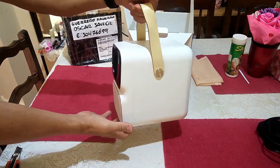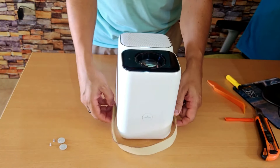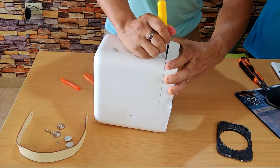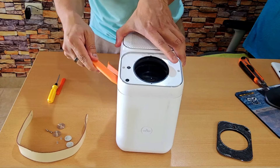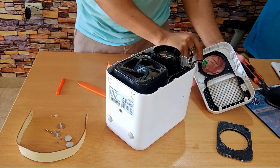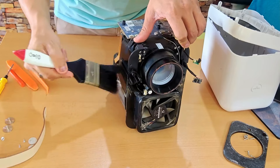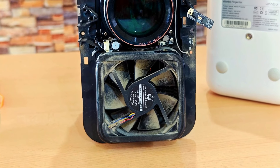The projector looks good and is practically new, so I decided to take it apart right away. While it isn't too complex to disassemble, it's not exactly easy either. If you're brave, knowledgeable, and careful, you can follow my steps — but just touching the board could mess it up with static electricity from your body, or you might break one of the very delicate flex connectors. It's obviously quite dusty, and this is one of the first signs of this issue, since dust stuck to the fan blades makes it less efficient at extracting hot air.